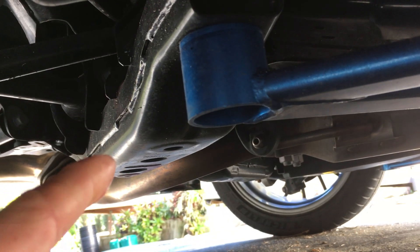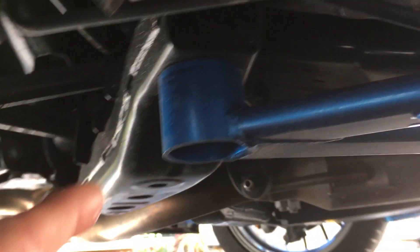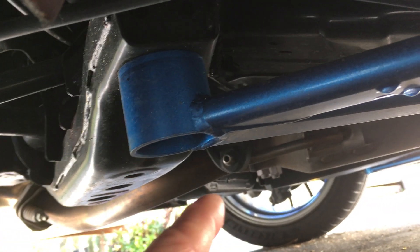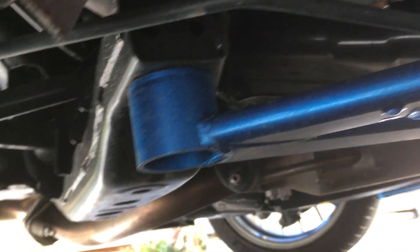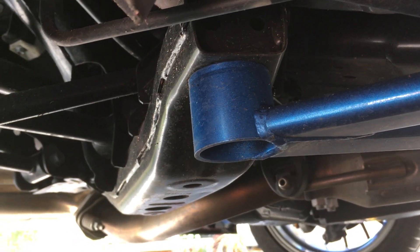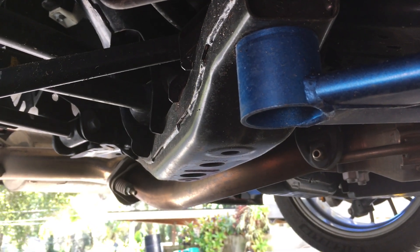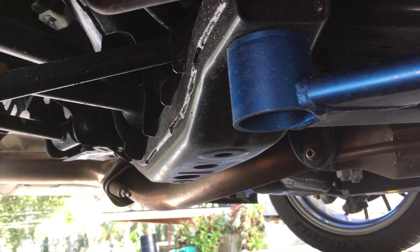There are drainage holes and you can reach from underneath the car. Where are they at? If you look at this bar where my frame brace connects to — this is the subframe right here — I believe that tube is actually towards the inside of the subframe somewhere along the subframe right there. That's where that tube sticks out. So you just need to get like a little coat hanger or something like that — untwist it and just poke it through there.